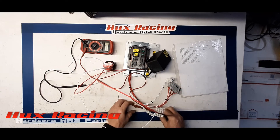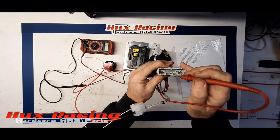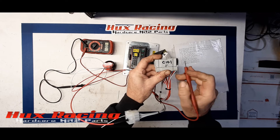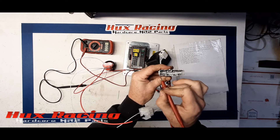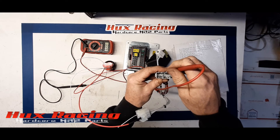To confirm: pin 16 on C101 reads 12 volts. That's pin 1 going to pin 16 — start relay shows 12 volts. And simple as that, we have confirmed start relay function.